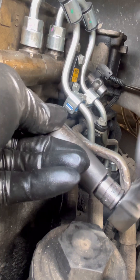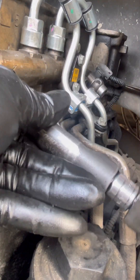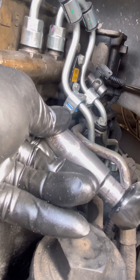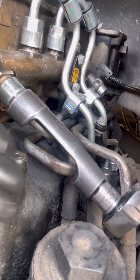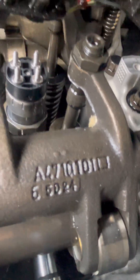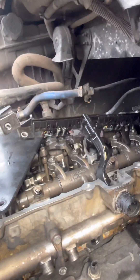You can take a wrench on this part too because you can fit a wrench over here. There we go — that's how you install it. It's in there and tight. Once I do all of them I put the bracket on for the electrics. You want to torque it down — put a torque wrench to 15 foot-pounds.